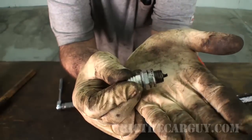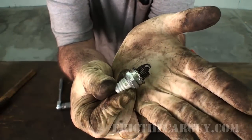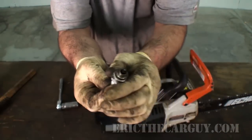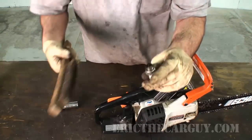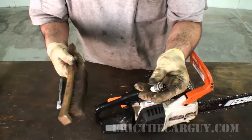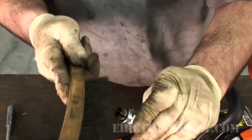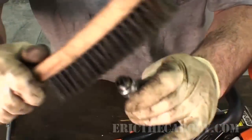I just took it out to, I believe it was like 44 thousandths. And basically I kind of eyeballed it. I wasn't really exact with it, and I probably should have been. And the second thing I did is something I'm told I should not do. So I'm basically telling you I was told not to do this, but this is what I did. I just took my wire brush and I just went around the outside to get rid of any varnish or anything that was on the plug itself,